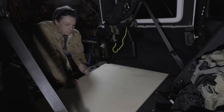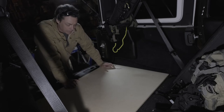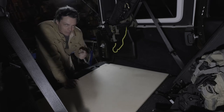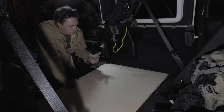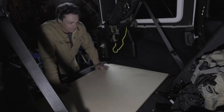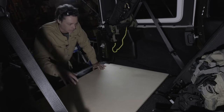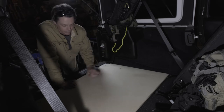For the most part, my haphazard method of finding the hole spacing with the cardboard worked out okay, but on the far ones there were two that were a little tight. In order to make sure I didn't damage the frame itself — since that's what you're screwing down into — I went ahead and bored all of them out to half an inch to give a little more gap and room. That turned out to be enough to solve the tightness I was having on those two. So at this point I screwed all these down and needed to test the fridge to see where it stands.